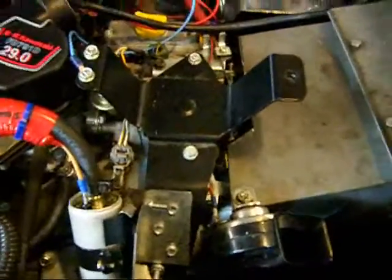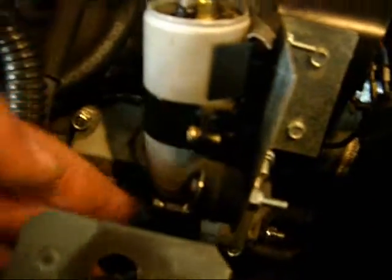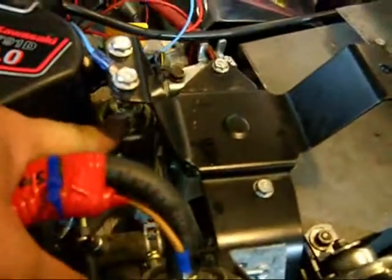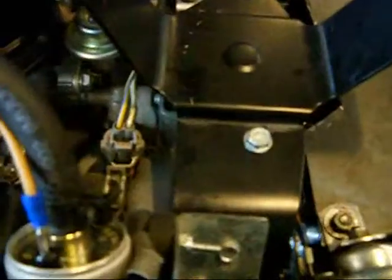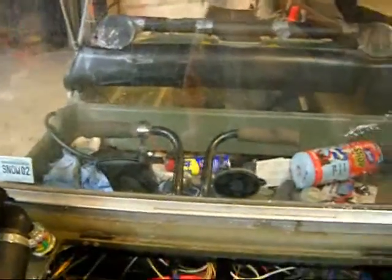Some of the things I had to go through to get it going: the fuel pump didn't have direction on it, so this is the actual outlet side. I had to use 400 psi trans hose because there's a half-inch outlet on the fuel pump. Then there's a T-fitting it came with that takes you down to 5/16. I used the original fuel line as part of the return. This is the fuel pressure regulator under there, and it allows the return system to come back to the tank. Temporarily the hose is running to the gas tank, which I've got to do correctly.